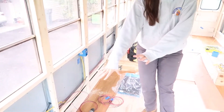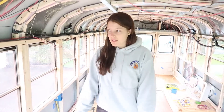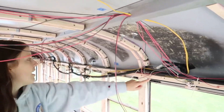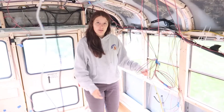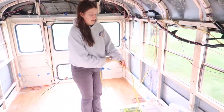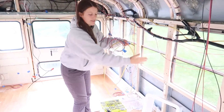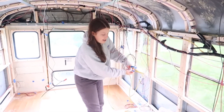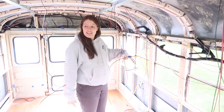This first outlet box was super easy because it's right next to the battery bank — a really short wire straight from the batteries to the outlet box. For anything on the other side of the bus, we did the same as with our 12 volt wires: we took our 12-2 wire, ran it across the ceiling, through our rubber grommet, all the way down. This lets us have a normal household outlet in our bedroom area. A wire also connects to our kitchen outlet — we're only having three 110 volt outlets in the bus, which should be enough since we don't have that many household appliances.